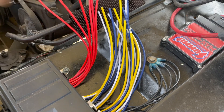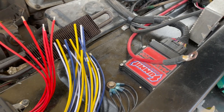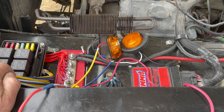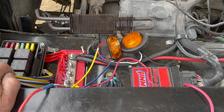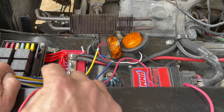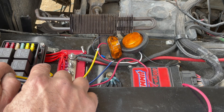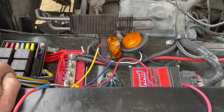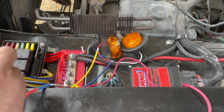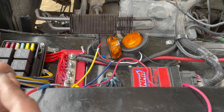First I'll install a bus bar here for the positives, just to get all this buttoned up. I already pulled a cable from the battery. I got my bus bar in here mounted — as you can see, I ran power all the way over to the battery. I did it here because this is where I generally run the wires for all my switches straight back through to the driver's side through the firewall, so it's just easier to mount it over here and pull power to this location.